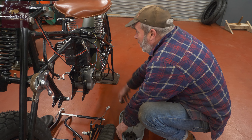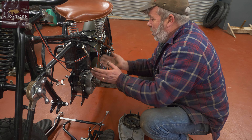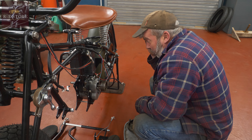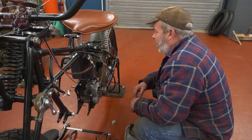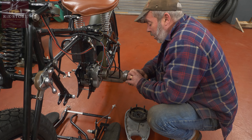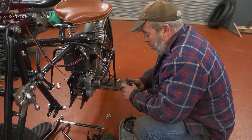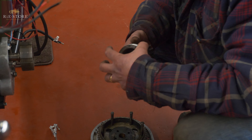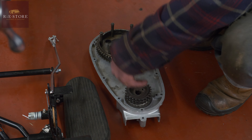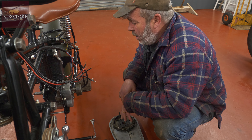The rear of the frame is bolted on here, so that's a completely different section. When you go to put your engine in, you might have to do that with the frame to pull it in and out and make sure everything's where it should be. If you take those bolts out it falls in half, so you've got to be careful. The front drive sprocket has been machined out — it should have another set of teeth there — it's been machined for a belt drive on a different dynamo. You'll need the belt to go on there before you even start putting that on, as that sits on the inside of the primary and that casing bolts onto the engine.